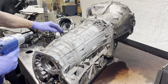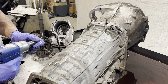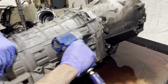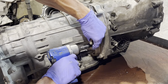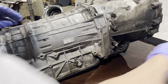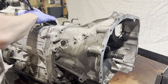Next we have these 14-millimeter bolts. Someone took the liberty of taking a couple of them out already because you have cooler lines and stuff that are held on by them. We don't try to take it off yet — we have some more stuff on the bottom after we take the pan off and the valve body.